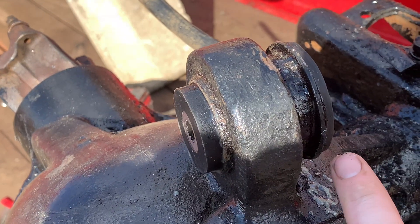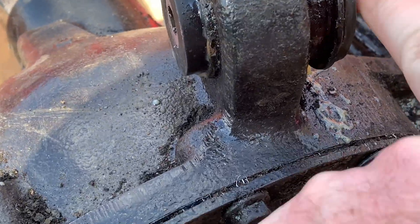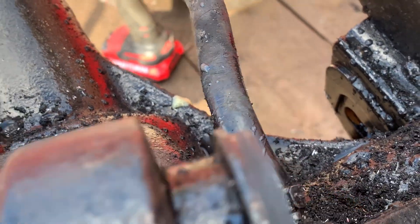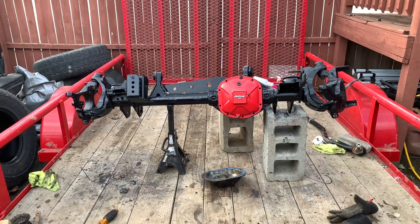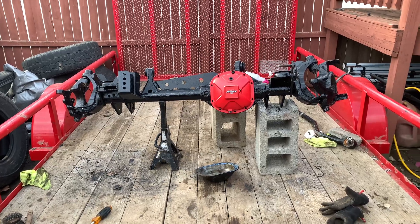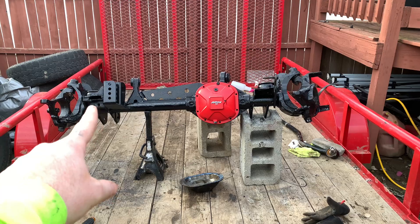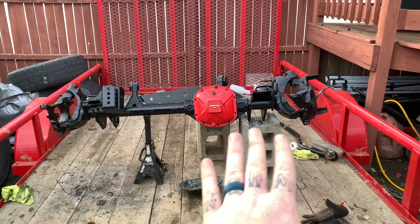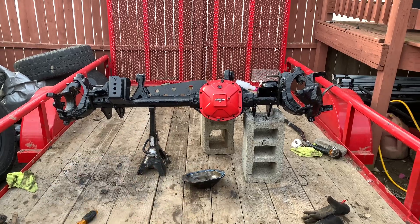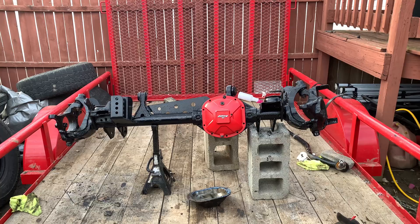It's going to be a little bit of a tight fit, but as long as it is flush I can pound this just a little bit where it was bent — as long as it is flush you're good to go. And this is how you can run a Dana 30 with 35-inch tires. We did cut the old track bar bracket off, as you can see by the two holes that were there, and it looks really, really good. I'm really impressed with it. One more coat of paint and this bad boy will be ready to throw under the Jeep.